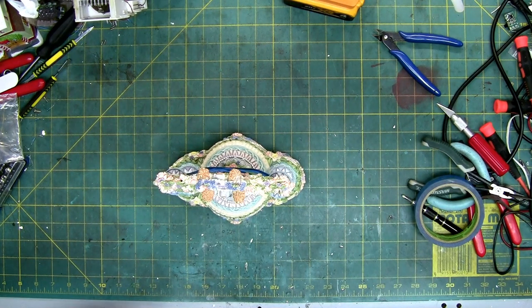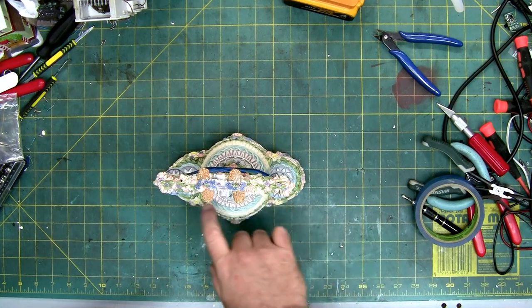I used to use clear nail polish, and I still do, just not on these pieces, for a lot of stuff. You can use color nail polish. It's not as good. The clear nail polish has a much stronger bond on threads, especially when it's metal on metal. I've been using it for a long time on many different projects that require a Loctite that isn't permanent. It's cheaper than removable or breakable Loctite. So that's another option to use, clear nail polish.